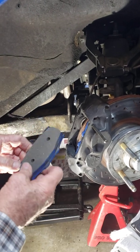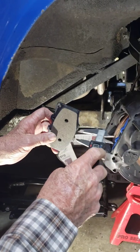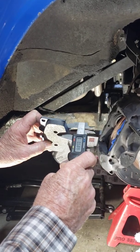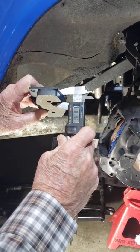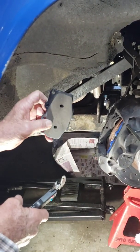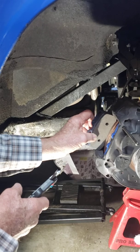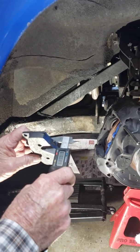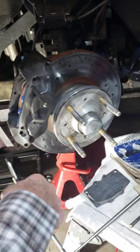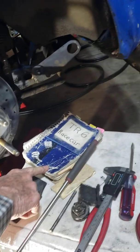These are my new racing brake pads. Something I learned the hard way: you want to measure the thickness that will fit. For me, it's 0.585 inches. When I ordered my first set, they were too thick and I couldn't install them — I had to send them back to get them cut down. Now I know the size I need. You send them the old backing plate and they'll grind it and put new material on.